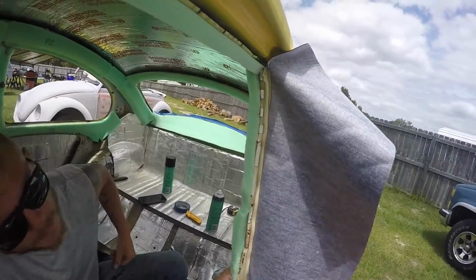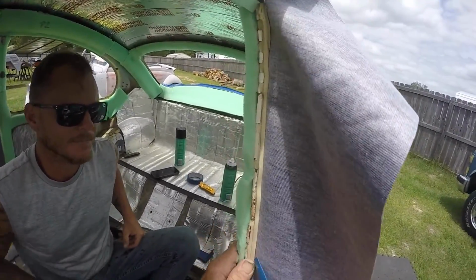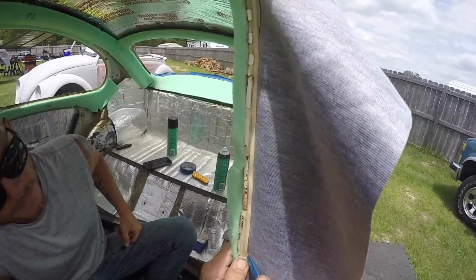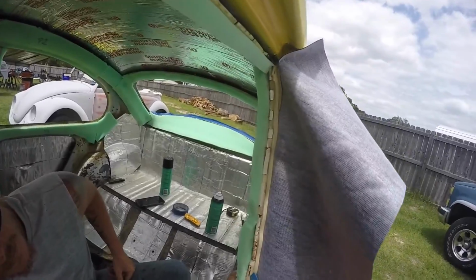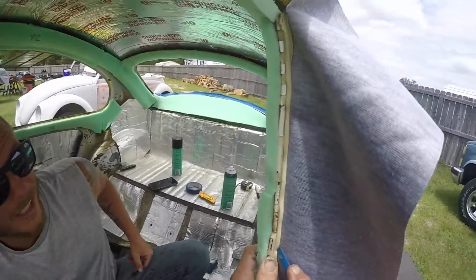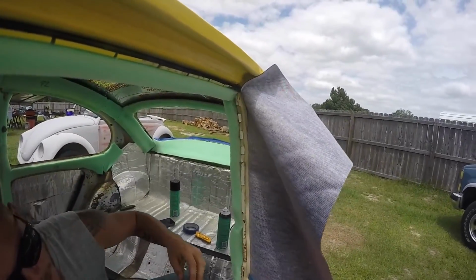We always start on the passenger side. We've learned that in anything you're doing. If you're assembling door glass, put on the passenger side first, because if you make a mistake, you don't want it on the driver's side. It's going to annoy the owner. He gets to forget about it when it's on the passenger side, because he doesn't get in it every day. Most of the time when people come and look at a car, they come in the driver's side too.